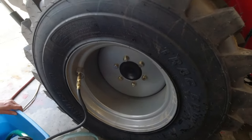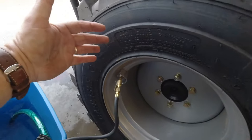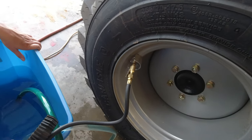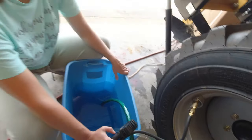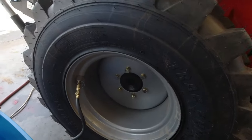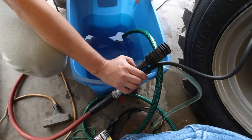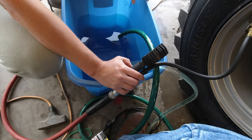I ran the strap around the outside and pulled on the tire because it was leaking a little bit, and my lovely assistant — my wife — pushed the valve to put a little air back in the tire. So now we've got the bead set and we're going to go back at it.